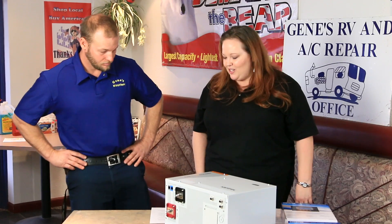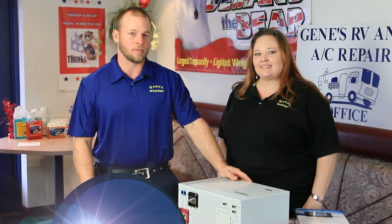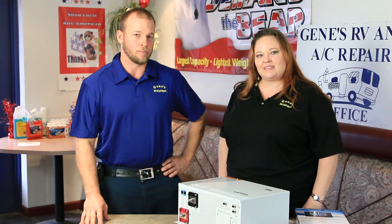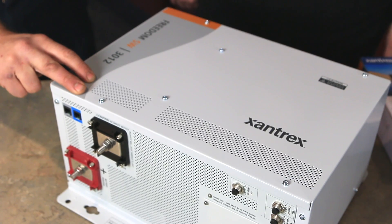Mike, why don't you tell us a little bit about the installation for Pippi? Well, today we're going to be removing a converter charger and installing the Xantrex Freedom SW3012. Pippi's RV came equipped with an old converter charger which provided DC power for battery charging and other DC loads inside her RV as long as another AC source was present. Since the vast majority of modern electronics are AC powered, you really need a reliable source of clean AC power to operate these appliances, especially when you're dry camping or traveling all the time. This is where we thought of installing the Xantrex Freedom SW series inverter charger.